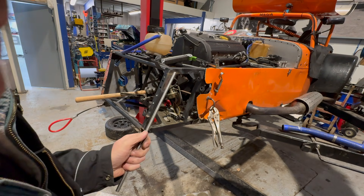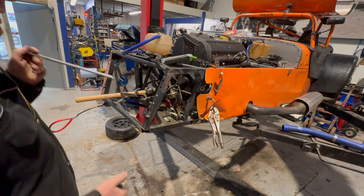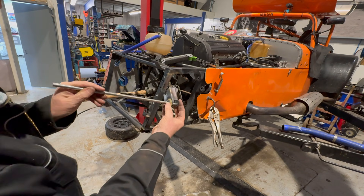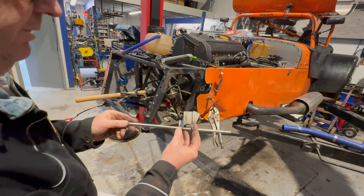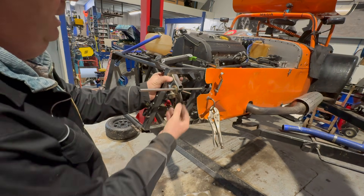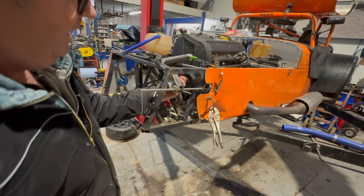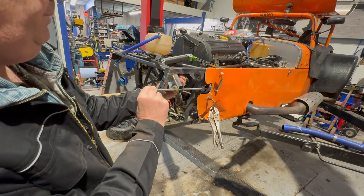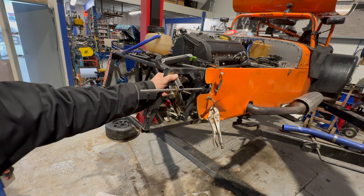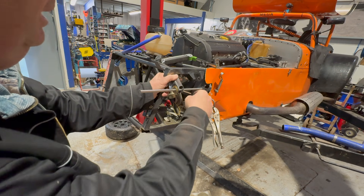I took the suspension off the other side to try and establish an alignment. I think the bracket on the other side has been knocked off before so I'm not entirely sure, but it stands to reason it goes all the way through. So I've turned this pin down to the right size, put it through both, and with it clamped on there it's in line. I think that bracket will be okay — we just need to make sure it's all secured and we'll get that brazed on. I'm going to put the wishbone back in and bolt it all up tight.